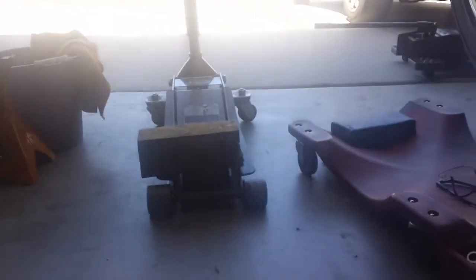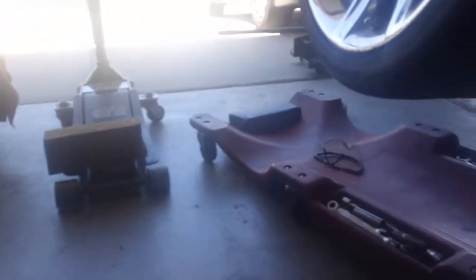It's not the first time — I had a '92 500SL that I had to do a transmission swap, but at the time I didn't have a transmission jack. So I used the floor jack, centered it on there, balanced it, and then slid it off onto a big moving blanket, like the kind you get from U-Haul. Put it on there and then I was able to slide it out.